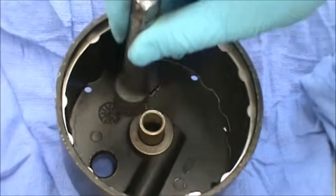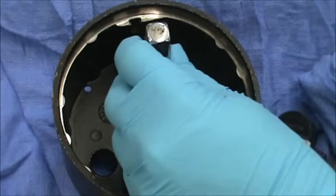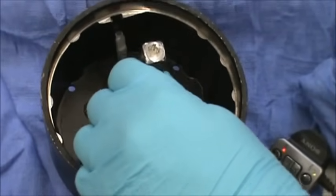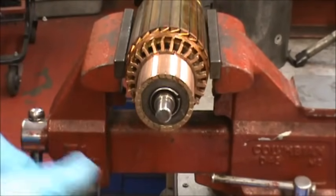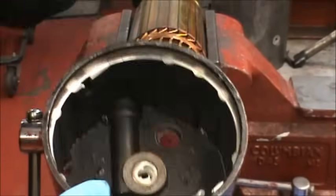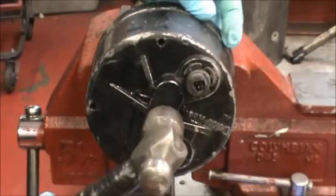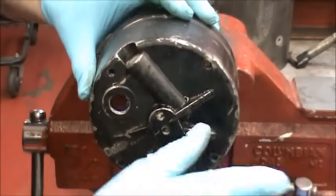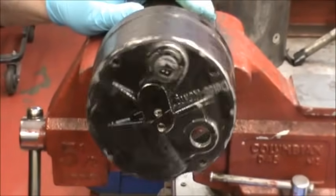If you need to, you can give it a little help with a half inch. We're going to use the armature shaft to make sure the bushing is pre-fit and doesn't heat up by fitting too tightly. Put a little bit of grease down in the bushing, put the armature in a vise, and tap it on. Then spin it around and tap on the outer diameter to make sure everything spins freely. That means the bushing is broken in and ready to install.